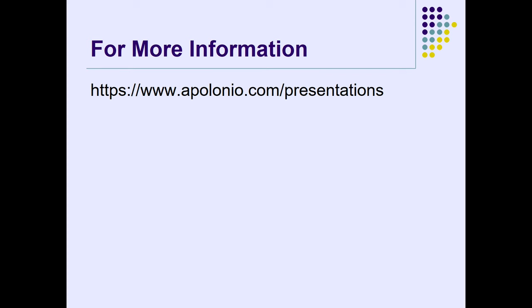Do you recommend using a laptop or Raspberry Pi? My personal issue with the Raspberry Pi is the SD card — once that first failure happened to me it was rough. If you log a lot of stuff into it, like a MySQL database on a Raspberry Pi using the SD card, you'll wear it out. I use a battery-powered laptop and when the power goes out it sends me a last-gasp message.